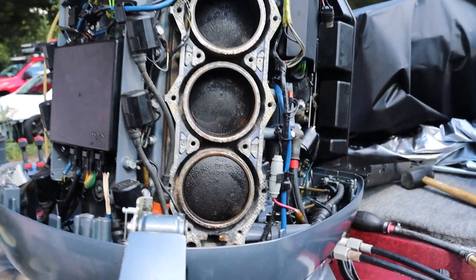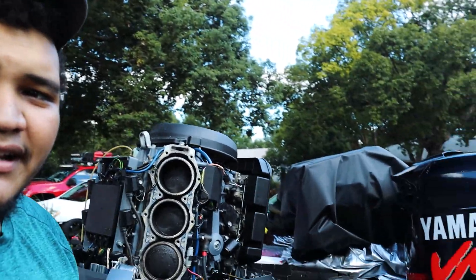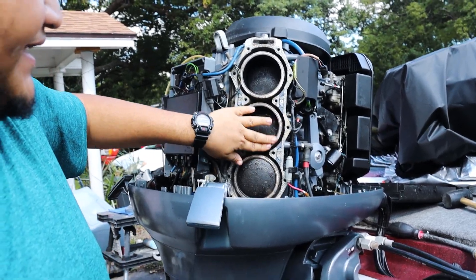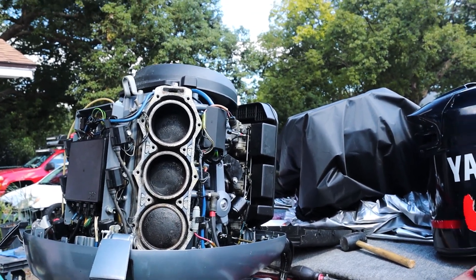But this is the side we're working on. This is all the old gaskets, pistons are all dirty. So what we're going to have to do is take a razor blade and scrape all of this out, and then sand it down so it's nice and flat and creates a nice smooth surface for the new head gasket to get on.